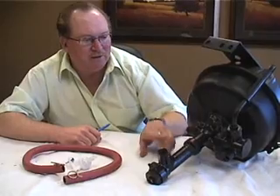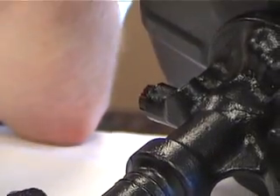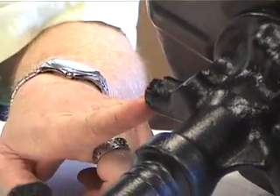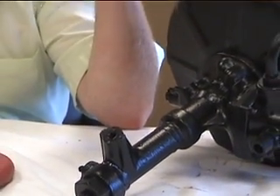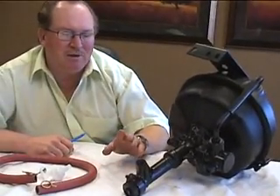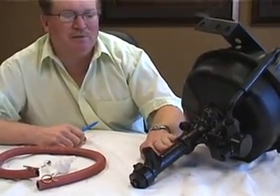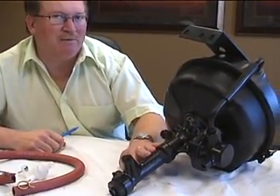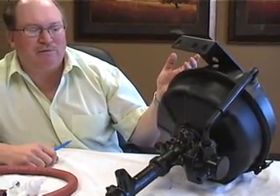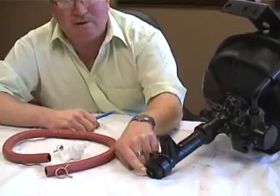Now let's talk about the hydraulic side. You've got a line in and a line out. Sitting in that line is all the dirty fluid that's been in your master cylinder. So before you hook your line up to your new Hydrovac, drain the brake fluid out of your master cylinder — that fluid may be dirty and gritty, sitting there for five or ten years. As soon as you make a brake application, you'd inject that dirty fluid right into this brand new Hydrovac, which has a beautiful, polished, mirror-like finish on that slave cylinder. Why risk a scratch or grit causing a potential failure? Just get rid of the old brake fluid first, and you'll have clean brake fluid going through your unit to the wheels.